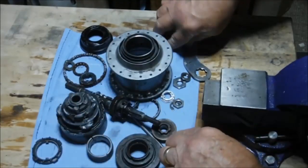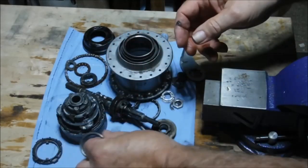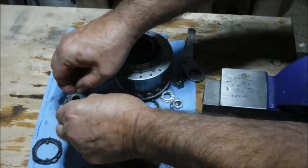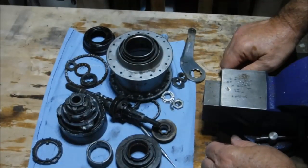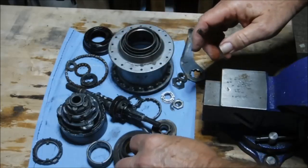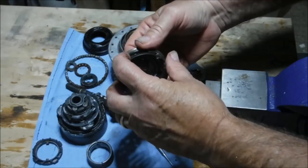So how to disable it? The quick and easy way is to simply remove the brake shoes — just toss them out. The rollers that activate it are in there pretty good, so they can probably stay and won't cause an issue. But my preferred method would be to actually disable it by removing the coaster brake actuating pawls.